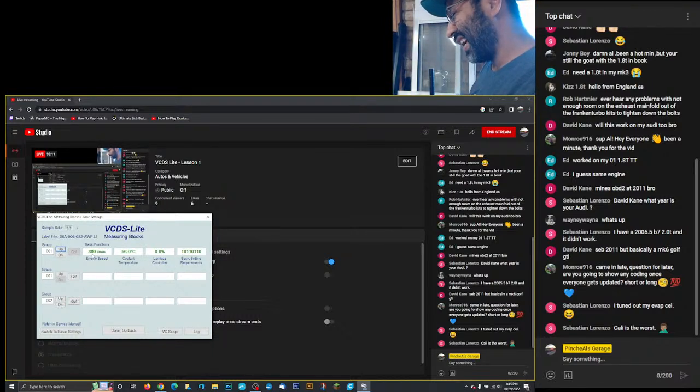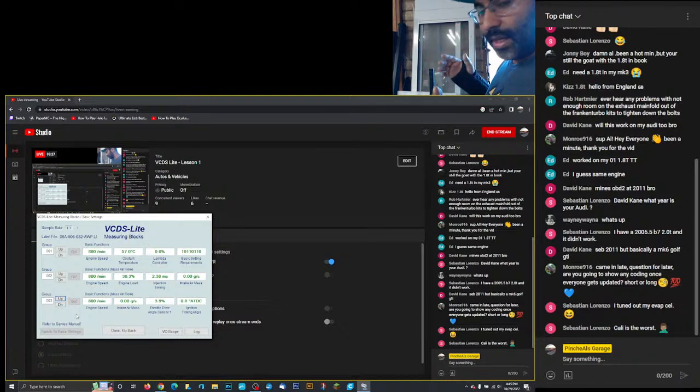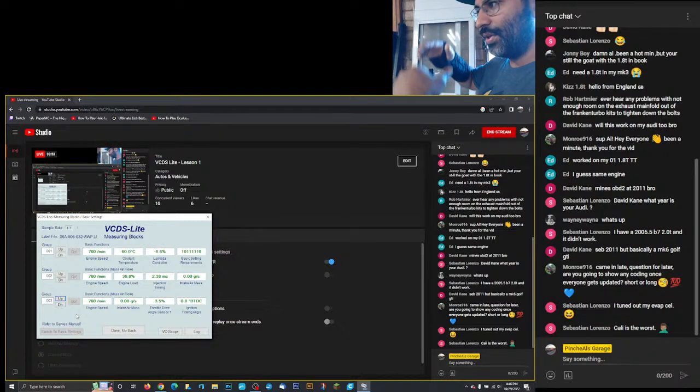It tells you what we're looking at, okay? So this is a good readout of information when you're working on a car. My Jetta TDI for some reason wasn't passing smog, even though all my monitors passed. It's because I had an EGR system. Now TDIs have EGRs, just so you guys know. The EGR wasn't reading correctly. We were getting the wrong numbers. The demand and what was needed was off, so it wasn't passing.